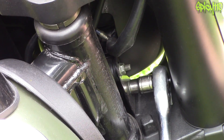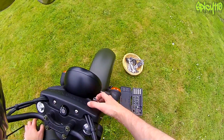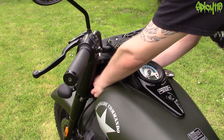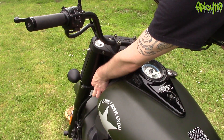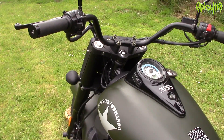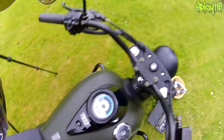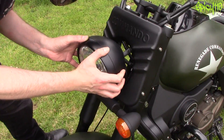This is actually a very tricky one. You have two bolts connecting this to the bike behind here, and you might think you can just take this plate off. But this plate goes all the way around, so you can't take it off without taking the light off, and you can't take the light off without getting these bolts out. You can't easily get to either side at the same time because of the shape — so two spanners is the only option. And it's out. So there's one — and two. What is it with fiddly jobs recently? Pull out.